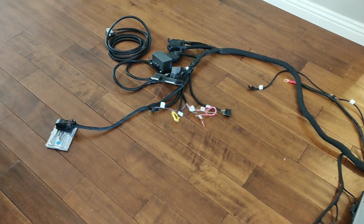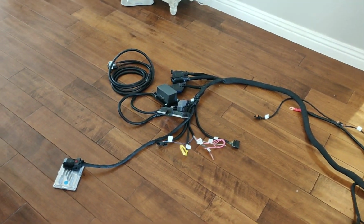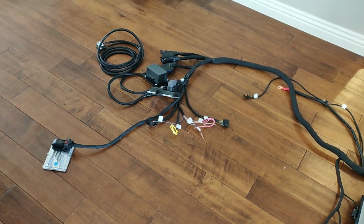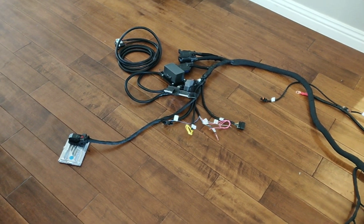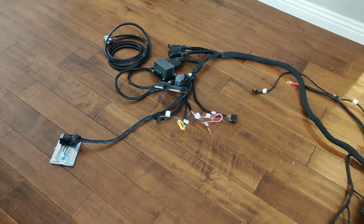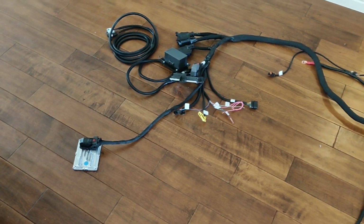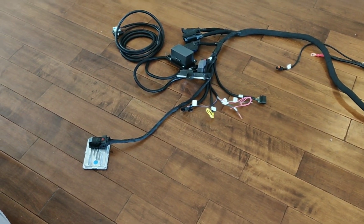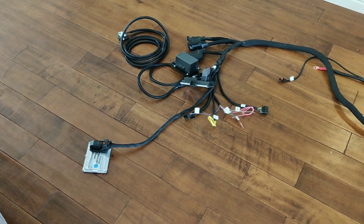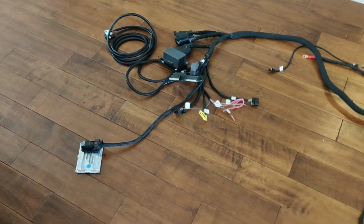So definitely use a GM pump, or use a regulator that you can regulate at 75 pounds of pressure, because basically that'll work as a bypass. Since it's so high up, the module should work fine with a standard aftermarket pump. But once it hits 75 pounds of pressure, it's going to start returning it to the tank. But that's kind of untested. On a setup like this, I really recommend using the GM fuel pump. A couple reasons: they're pretty affordable, they're made to last a long time, and they're insanely quiet. You can't hear these pumps, and they obviously support the power.